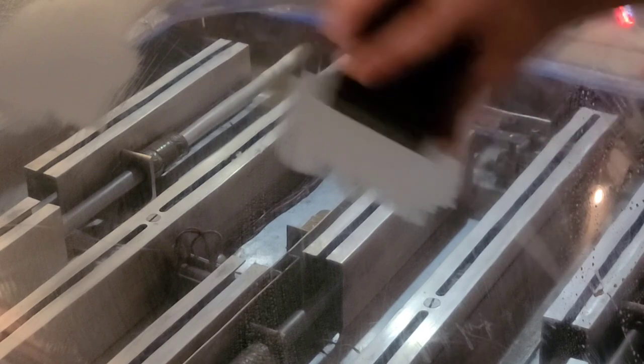You can almost see the scratches disappear. Keep it wet. I'm done with this one in 400 — switch sandpaper, go to work on the next one: 800. Go a little bit bigger to cover those scratches from the previous grit. That is key — do not leave scratches from the previous grit. Those are the ones that will show when you're done and you'll be trying to buff them out later, and it doesn't work that way. Use the headlamp and make sure you get every scratch you can see with that grit before moving to the next one.